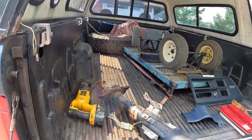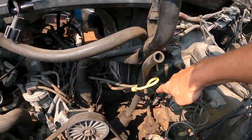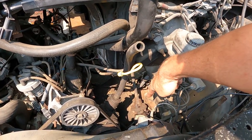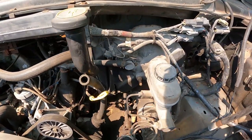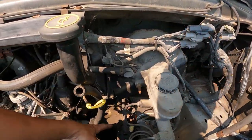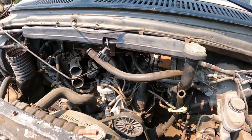And this bolts right on to the steering box, which is here. So all I literally need to do after I set the body down is bolt back onto the steering box, and that'll be fine. I got some miscellaneous power steering lines that went to controls. I've got to redo this. I'll probably just buy brand new power steering lines and hook them up correctly to the pump.